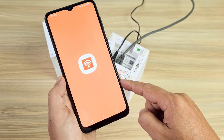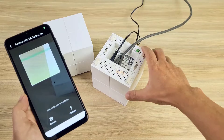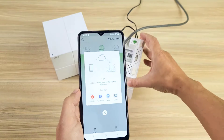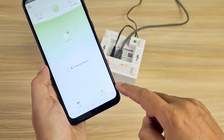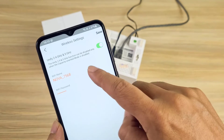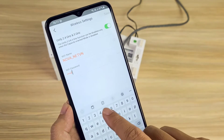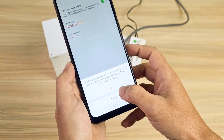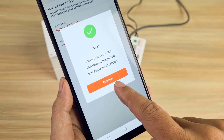After completing the connection, open the Tenda Wi-Fi application and start creating a new mesh network. You add a master node by scanning a QR code. Then you set up wireless — you name the wireless network and set up a password as you like. Now the wireless settings on your master node will change as shown in the Tenda Wi-Fi app.